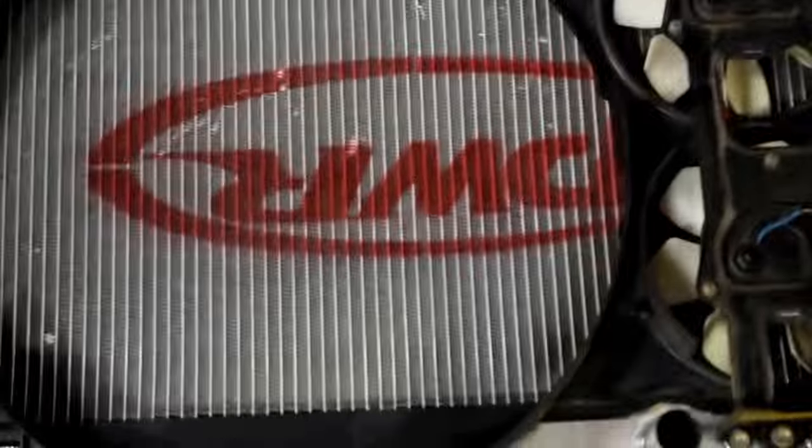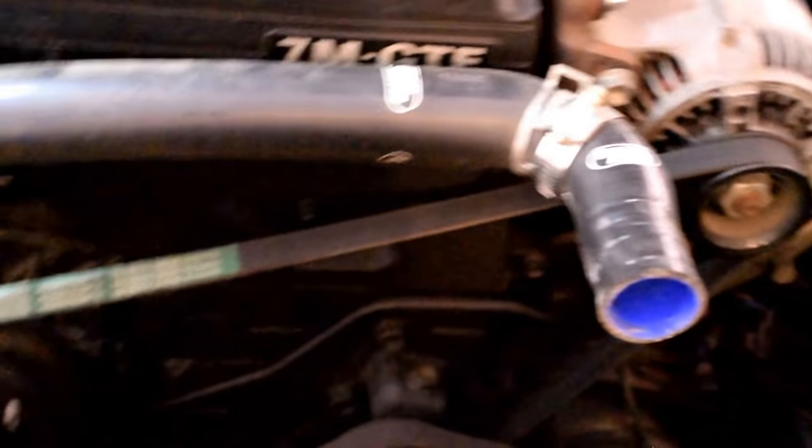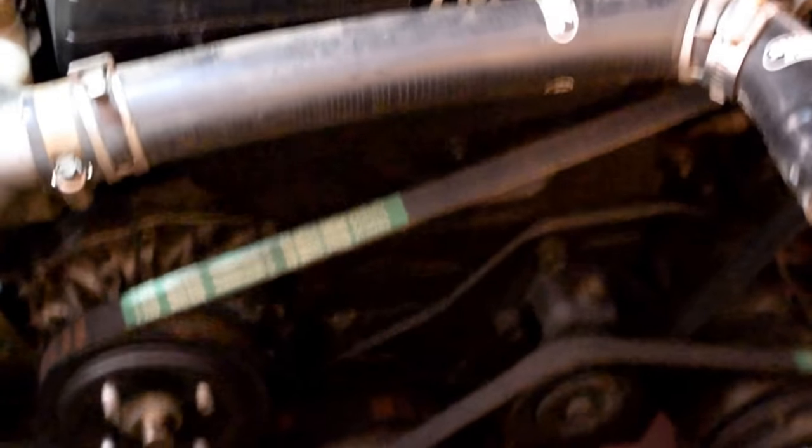So there's the radiator — it's a PWR, an old one, and it's not quite the right size. The hose outlets and inlets are a little bit too small, and the outlet for the top overflow canister is the wrong size — that's kind of a pain in the ass. Now we've got a much better view of the timing cover and everything in the front. I'm going to switch over to ultraviolet and see if we can find where this oil leak is coming from.